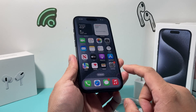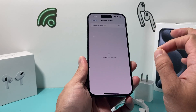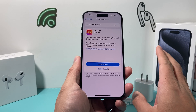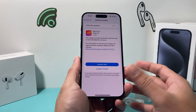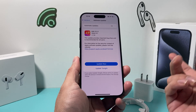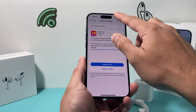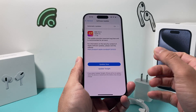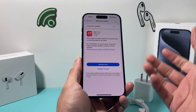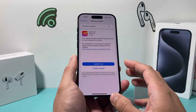If you're still having the issue, go into your iPhone Settings, go to General, and check if there's a software update available. iOS 17 has been a bit finicky with the initial release and Apple has pushed multiple updates to fix bugs, glitches, and software issues. Make sure your phone is up to date — you'll generally need at least 50% charge to update, which can be tricky if charging isn't working, but updating your phone is one of the best fixes.